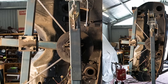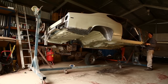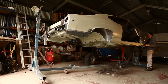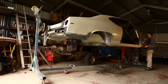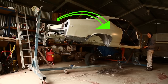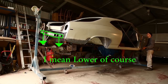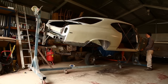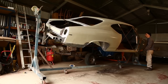If those brackets could be adjustable, this would be a very nice tool. The best way to do this would have been to have the car in its upright position but still on blocks or on your hoist — fit up the rotisserie so the car would be top-heavy and wanting to tilt, then loosen this joint, raise your rotisserie, tighten it up, and check it for balance again. I don't think you need it 100% balanced, because when you have a stopper to stop the rotation, that off-balance is just going to lean on it.